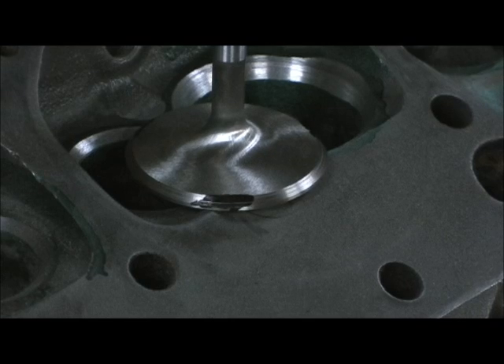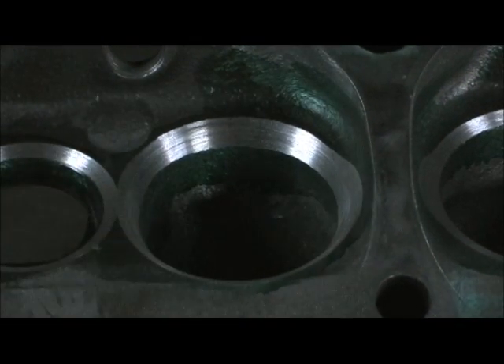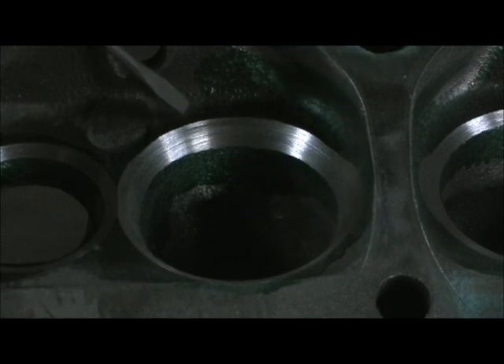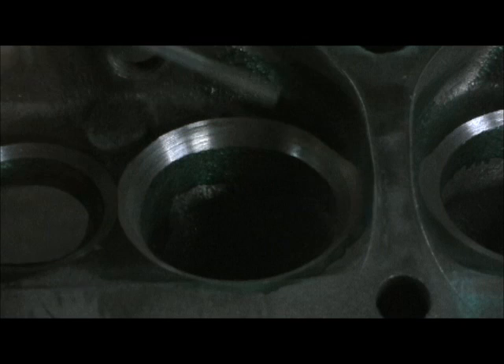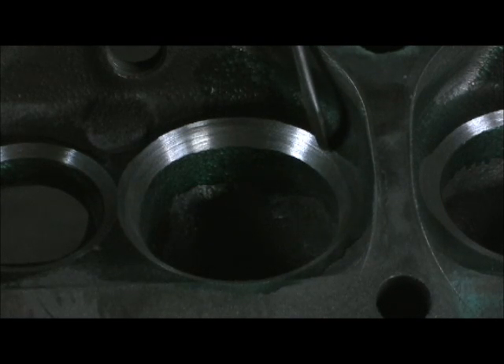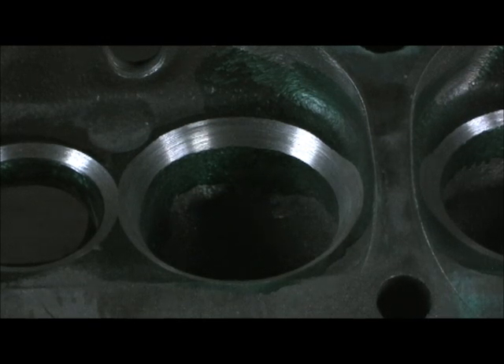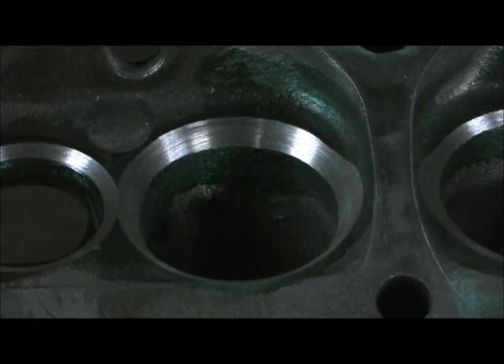Let me show you what the bowl looks like. You can see where this angle is right around here. There's where the 30 is on top, and then the rest of it's 60 all the way down — right there is your 60 and 30 interface. I'm going to have a little bit of 30, which is all I want, and then I've got to go back in here and reset this area. In order to give this engine the maximum power for the dollar spent, after the valve job I've got to go in with this tool, set the depth, and cut the bowl area — re-port these bowls one more time.